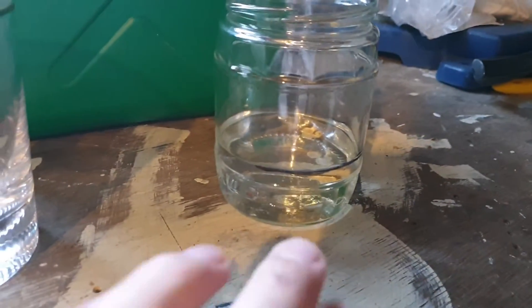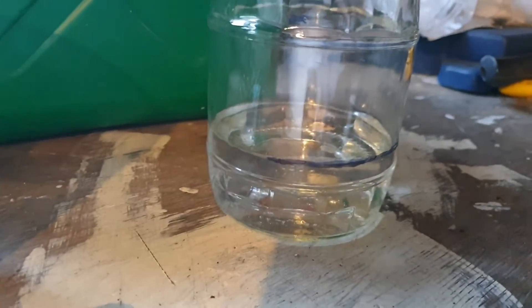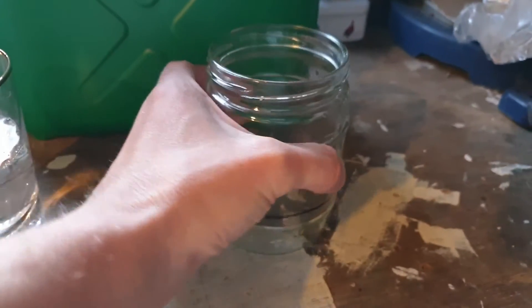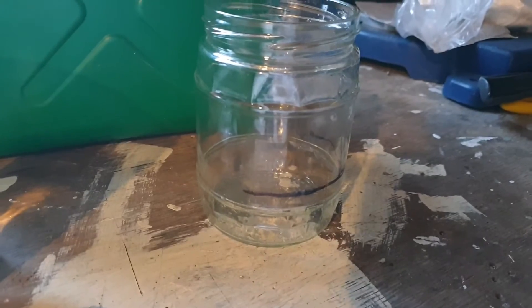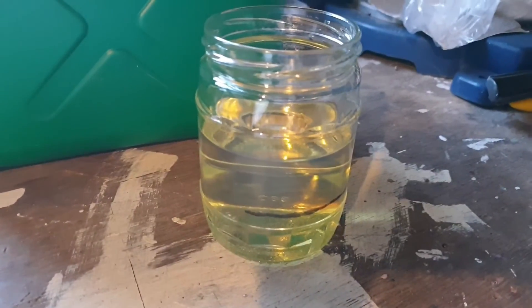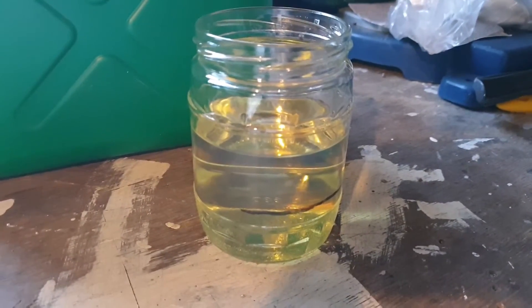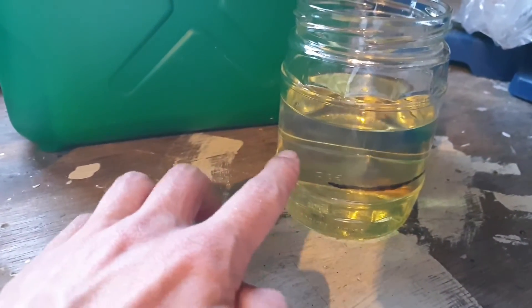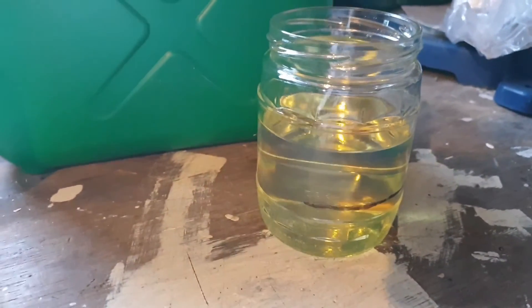As in the last video I'm using the same amount of water — I've marked the line on the jar and the water is at exactly that level. I'm going to put this into a separate glass to make it easier pouring the fuel in and also allowing the water to actually pass through the fuel fully to pull any of the ethanol content out. It's a similar amount of petrol as before. It doesn't have to be a precisely measured amount because all we're looking for is ethanol content, which just means if there is any ethanol in the petrol the line of the water and ethanol mix will appear higher than the line of just water itself.